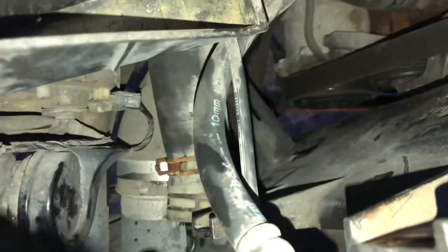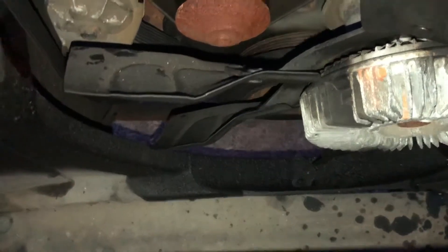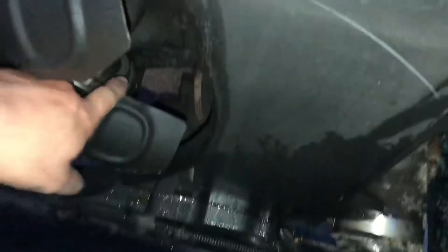We got the radiator out. What I had to do was lift it up and unbolt it so I could get the bottom hose off — you really can't reach the clamp easily in place, so I unbolted the radiator, lifted it up, and did it that way. If you want, you can clean all the oil and grime off while you're in there. This oil here is probably coming from the breather — there's supposed to be a catch can there that should be emptied periodically.